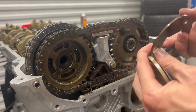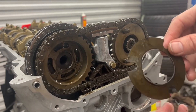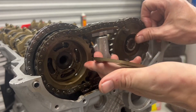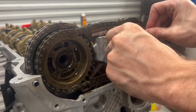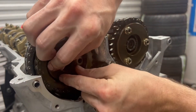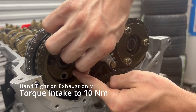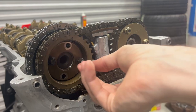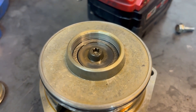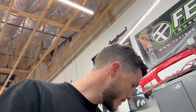Next up is spacers and spring — of course the thinner one first, then the spring goes in. You can see the rub marks right there for the thicker one. Everything is just going to be hand tight for now so it can turn while we set the vanos. The next thing is this torx bolt — this one's actually reverse threaded, and the only reason I know that was because I almost damaged mine the first time. I thought I could figure it out and then had to go to YouTube — and here I am now on YouTube.